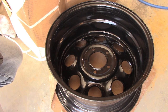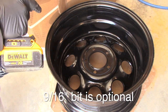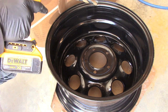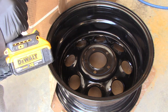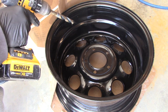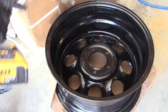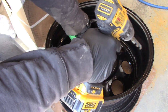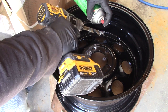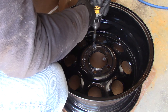To modify the wheels, I bought a good set of DeWalt bits — a 9/16ths and a 5/8ths, and I bought two of the 5/8ths just in case one gets destroyed, because that's the ultimate size we're making it to and we're doing four wheels. You really want to do this slowly and use good cutting oil or motor oil, because otherwise you'll quickly destroy your bits on these steel wheels. I'll spray a little bit of oil — this foaming stuff kind of stays put — then do it in two steps, starting with the smaller bit first.